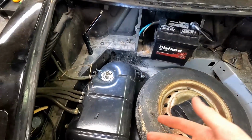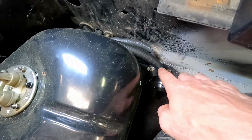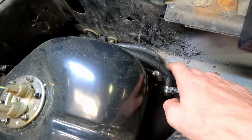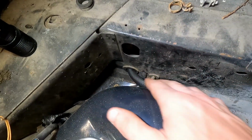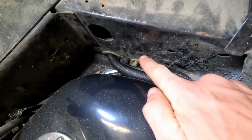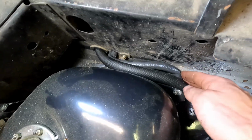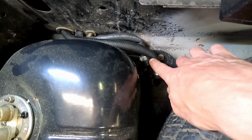So now we're back in the trunk area, and one thing I want to do is, you can see here on the fuel line there's a tight bend here, and especially on our return line there's a tight bend here, and even when we get up to the cab you can see there the return line is kinked. And the last thing we want to do is starve our engine of fuel or have too much fuel pressure and we have a problem with lines bursting, things like that.